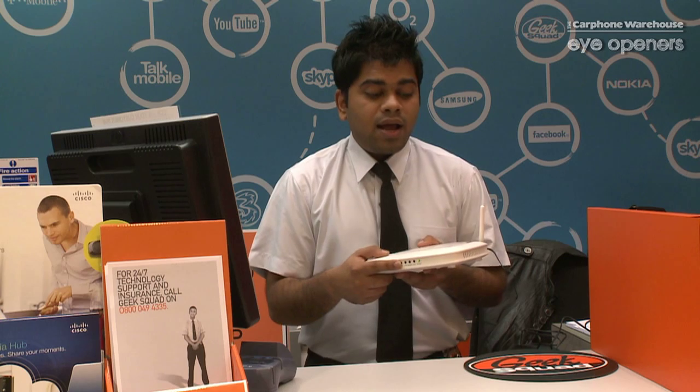It needs to be constant on — ADSL sync or cable. If it's not on, personally I would take every single extension socket, extension phones or fax machines, anything that's plugged into your house, and take this router to your main master socket, which is normally the first one in the property.